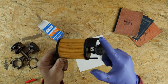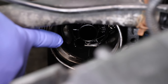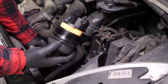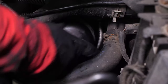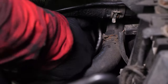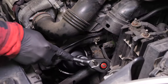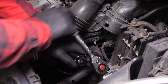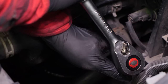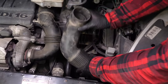Careful — it is very important to position the filter correctly. Re-screw the filter in place until it makes contact. To tighten it up, use a socket wrench, an extender, and a 27mm socket. With this kind of oil filter, the new joint can be excessively thick, making the tightening process more complicated. As a result, you have to ensure that the flange washer is flat against the oil filter housing. Put the air inlet conduit back in place.